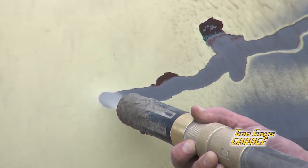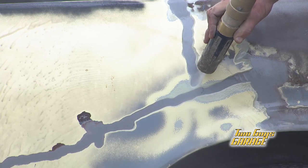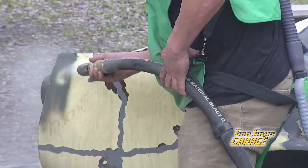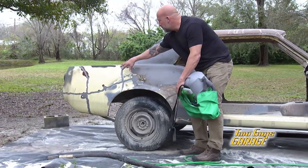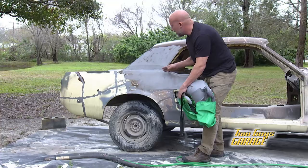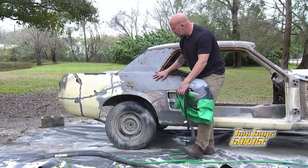I was kind of drawing some lines here — you get to look around and see how thick this bondo, how thick this filler is. You can see here it's over a quarter of an inch. Out here it's not so bad, but I think we'd be better served just removing this entire quarter panel, getting that thing off there, putting some new sheet metal on here.